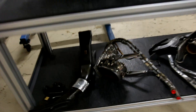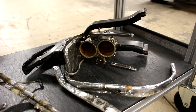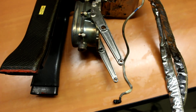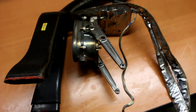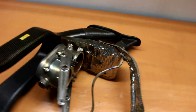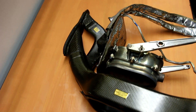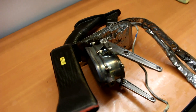I actually have three wastegates — they're from the same engine, 2014, maybe 2015 as well. It's a butterfly-type wastegate. Here is a wastegate from a modern Formula One car new turbo era — from the Ferrari engine, used in the Marussia/Manor team. As you can see, it's a butterfly-type wastegate, not a poppet style like those used in normal turbo cars. Other engine manufacturers in Formula One use the poppet-style valve; I'm not sure if Ferrari still uses this butterfly style.